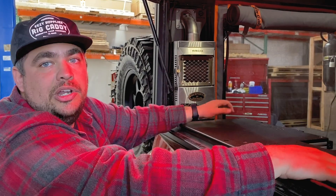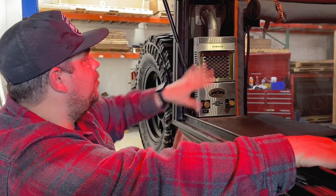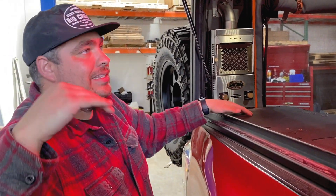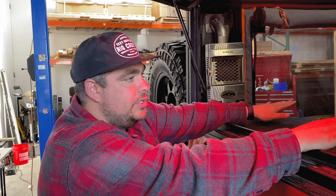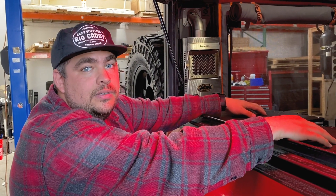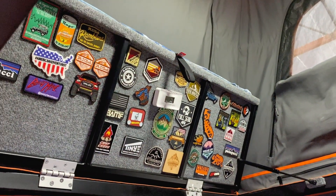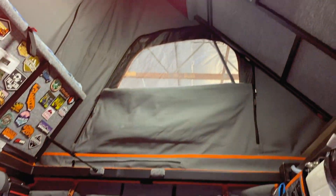You're playing with fire with your buddy heater, right? And you've got that diesel heater now — that works really well, so you could rock that for the time being until maybe you want to do the fireplace. The first trip I ever did with this truck when I first bought it, I had zero accessories — I didn't even have the molle plates. I did the electrical myself but had no interior, and we took an 11-day trip. We used a buddy heater a couple of nights, but I bought a carbon monoxide detector on the trip and it was really close to being an unhealthy amount — I want to say like 28 parts per million. I think they were saying 40 is unsafe.